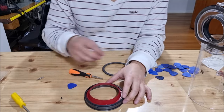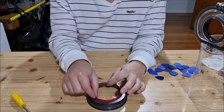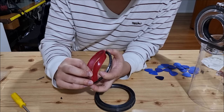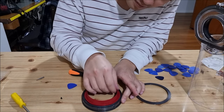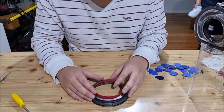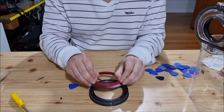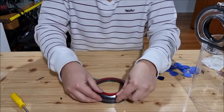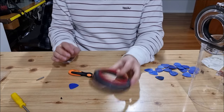You just need to look at one tab and groove to align, because they're all the same size. Once one goes in, they all go in properly. Next, align the ring correctly towards the front — towards the gap and the screw hole. You need to lift the red ring up so it goes into the groove on the top. The ring must be in the groove before you push it down. If it's not aligned with the ring, it stops it from going down. Put it on top, align it correctly, lift up the red ring and the plastic ring, then push it back down. This way we know both the red ring and plastic ring are aligned. Then put the plastic ring on the bottom and it should align correctly. Remember to pull on it to make sure it's stretched evenly.